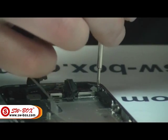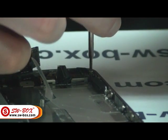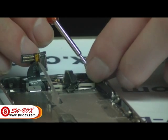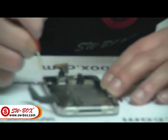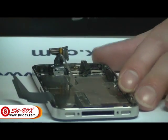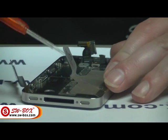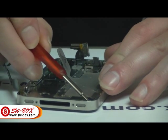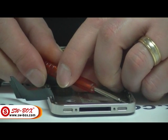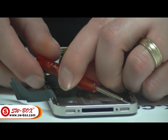One screw is really small and one is really big, so it's not difficult to remember where they go, but you need to make sure you've got the right size. There's a bolt here, one there, one there, one there — and then six down the middle — so you've got ten bolts or screws in total to take out. The four in the corners are the same size, and the six on either side are the same size. Once you've removed them, it will release your front screen and front cover.